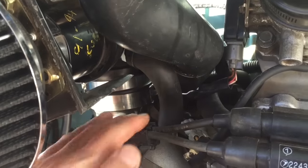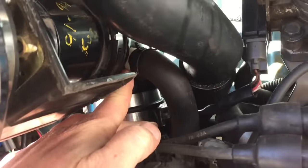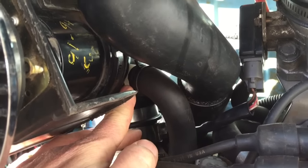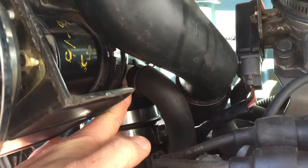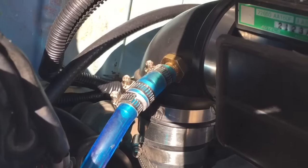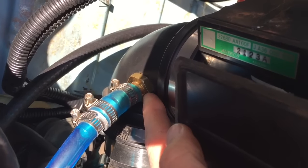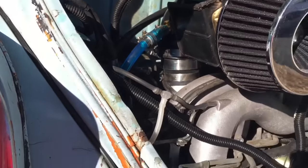Here is the idle air control valve right here — it goes right into this 90-degree Subaru elbow, very similar to the JDM Subaru WRX idle air control valve and PCV valve. It's just a nylon nipple. The PCV venting goes very similarly except it's brass because that's what I had. This goes to an oil catch can which sits under the fender here.